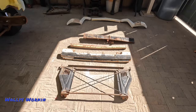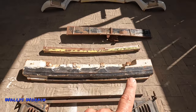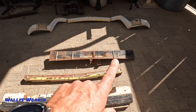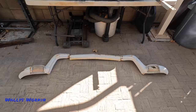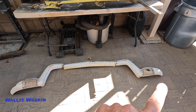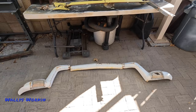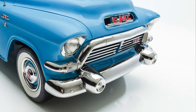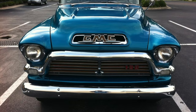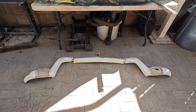The components I have: I found a used Chevy core support, a Chevy lower grille surround or lower valance, and the upper grille surround or valance. And of course I've got the Chevy hood latch assembly and panel. I'll still have a little challenge mounting some of this stuff, but it shouldn't be a big deal. This is the GMC front eyebrow — it has the front marker light and then that piece goes up and over the grill onto the bottom side of the hood. Normally it has those big bullets on the front bumper, but I'll be eliminating that completely. Basically the bottom half of this grill will be all Chevy stuff, and the top half I'll leave the GMC stuff — it gives it a really nice clean look.